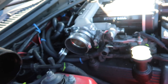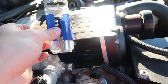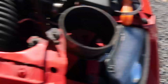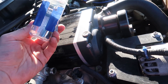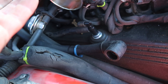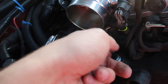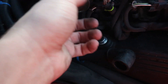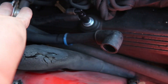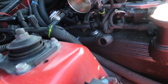I just discovered oil inside the throttle body, so I'm wondering if the PCV valve is bad. I'm going to replace that while we're at it. Here's the old PCV valve, and we're going to replace it with this fresh one. PCV valve is in. Maybe that's the whole reason the car is smoking — it could be causing the car to burn oil and blow smoke because it's going right up into the throttle body and burning in there. They are known for going bad, and the symptoms fit, so that could be it.